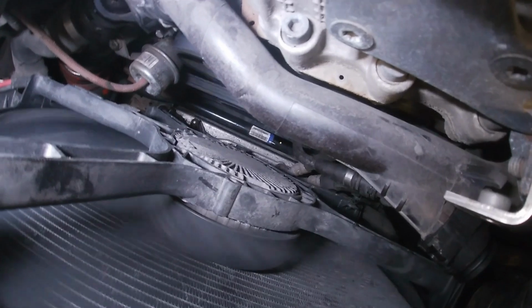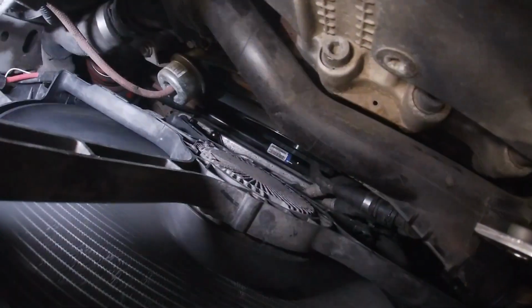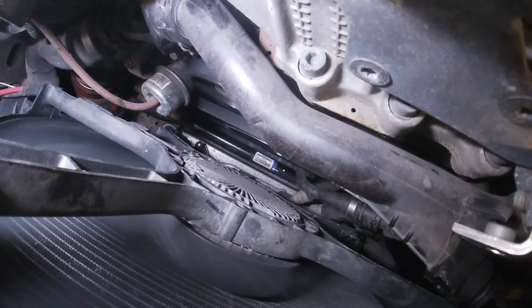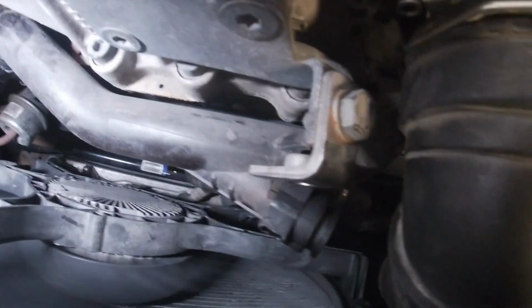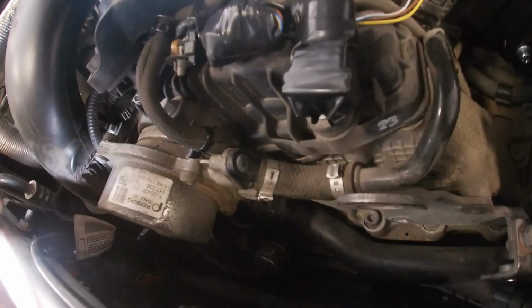Okay, so you can see the front stretch belt nice and aligned on the AC compressor. We had a little bit of an issue with that. The secondary belt behind the primary, everything looks good there. It sounds good so far. Idle comes down, fans running, no leaks.